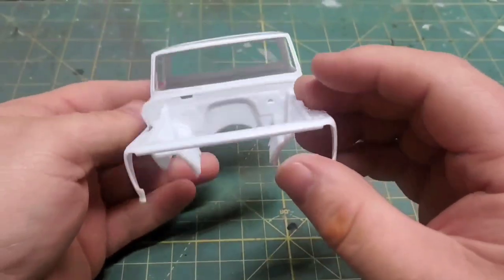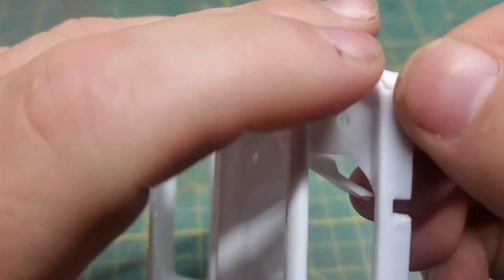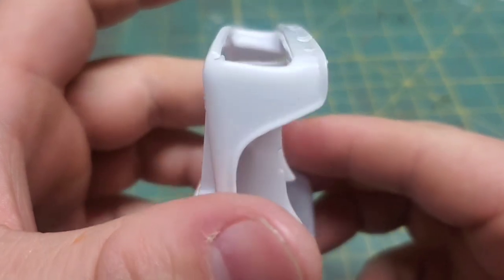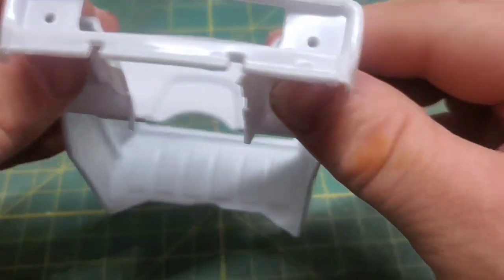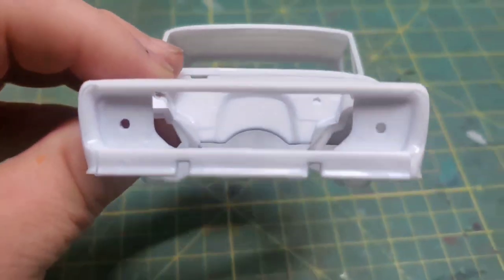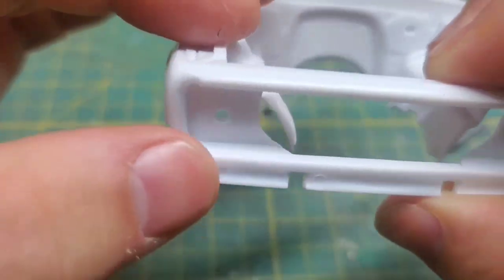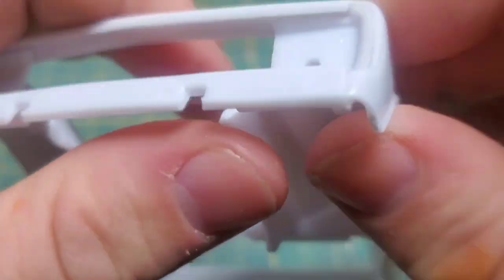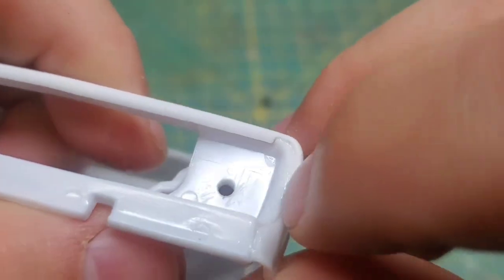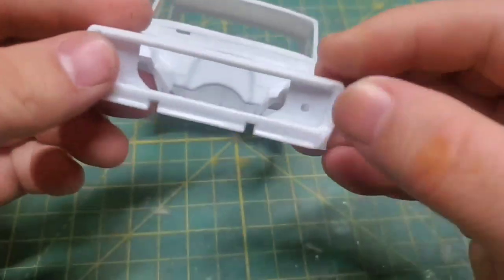I wish I could say we were done, but nope — let's move on to the core support here. The passenger side fit extremely well. The driver side, not so much. Luckily, that bottom rail is 99% covered by the front bumper, so I didn't waste a lot of time trying to fill that huge gap there. All I really did was touch up the areas that were visible. Everything fit dimensionally; there were just some panel gaps. This shiny spot here is unsanded superglue because that is a low spot. I eventually just called this good and moved on because I don't have time to make everything perfect.